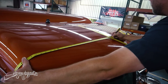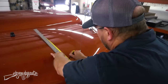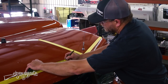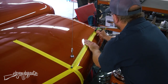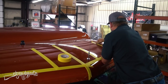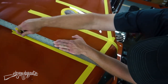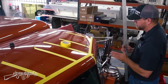I'll put a mark at 35 inches and do the same from this side. Then I'll put a mark right in the center and connect this line from the center of the ridge — that gives me a center line index. My first light is 9 and a quarter inches from center, the next light is 25 inches from center, the same on both sides. There are the lines they'll be on, keeping them all parallel facing straight center.